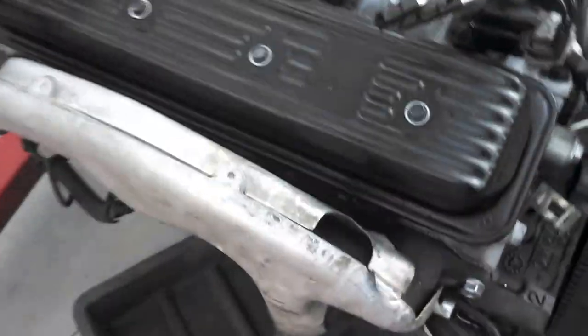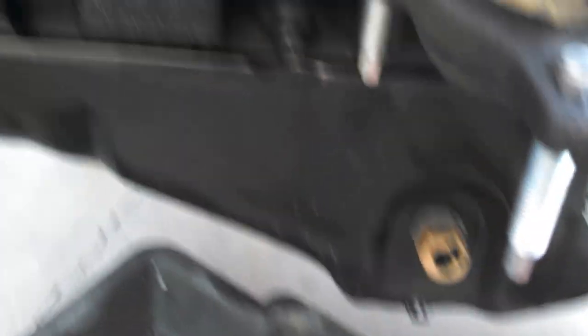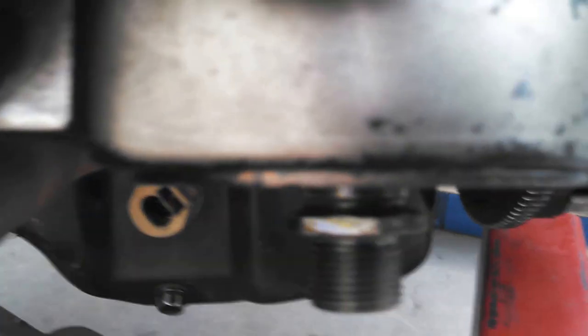On the engine, I've got the headers mounted. I had an issue with the studs on the header collector — they all snapped and I had to replace them. I had to drill and tap them. I also removed the oil cooler. This is the oil cooler — very simple. You take that nut that was sitting between the block and the oil filter, take the nut loose, and this whole assembly just comes right down.